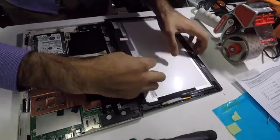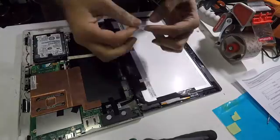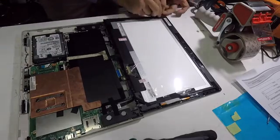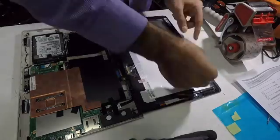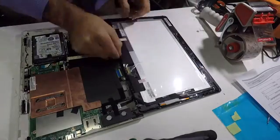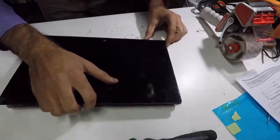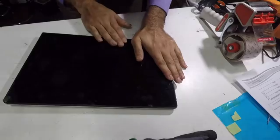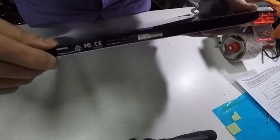Now, before putting it all back together, let's apply some tape to all the parts that can come loose — most importantly, the LCD data cable. Apply sticky tape on top, nice and firm, and do it all around the LCD. Take your time. Now the final stage — putting it all together. It has clips all around the screen, so gently start pressing down, starting from one side. Keep going along, be gentle, and just keep going around — running your finger all around the LCD until every inch starts to click in.